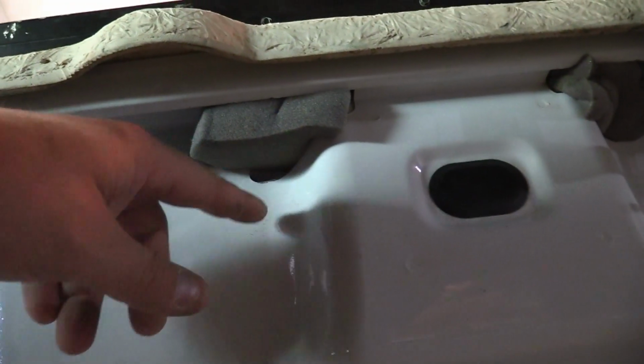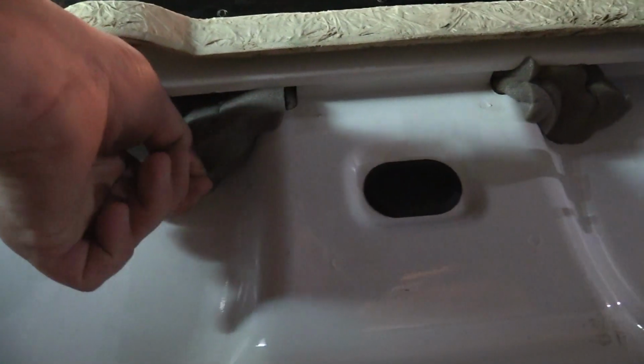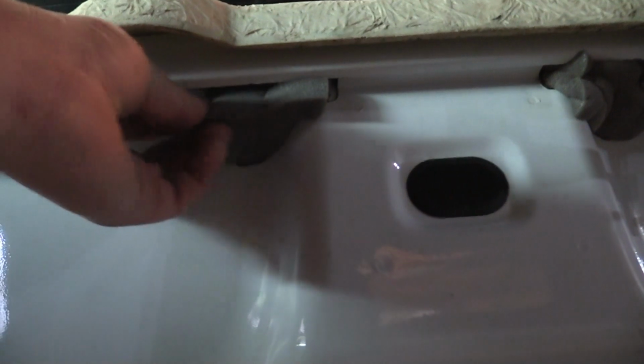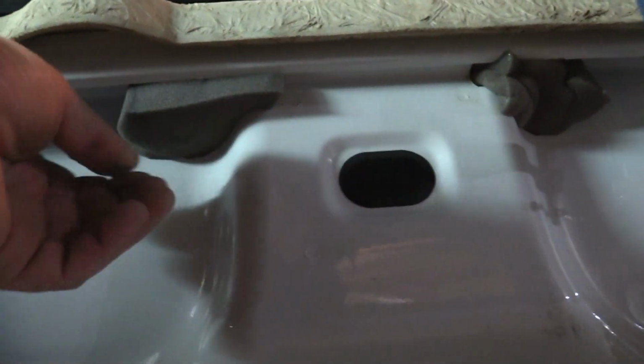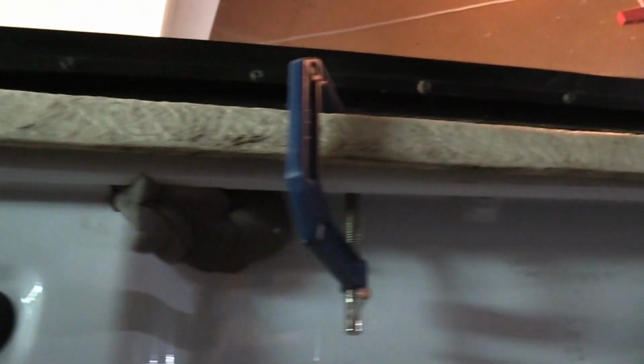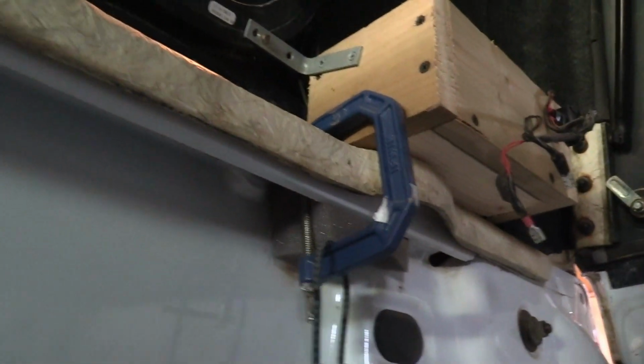And you can see here on the bottom, I still got a little gap, and that's going to let dust in. You've got to sit there and work this foam all the way until it completely covers that up, just like that. And you can see underneath this rail, there's holes like that all the way. There's a bunch of them on every side.